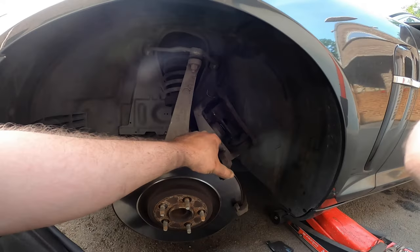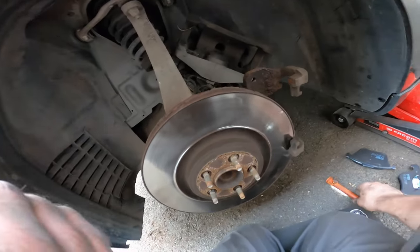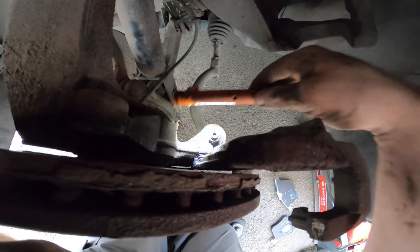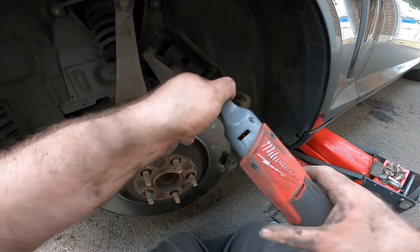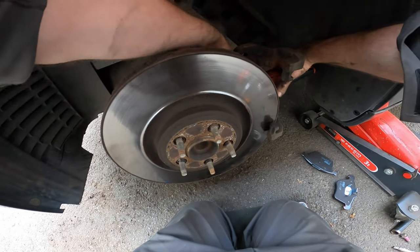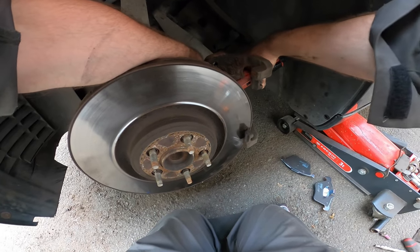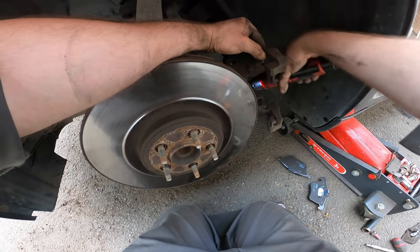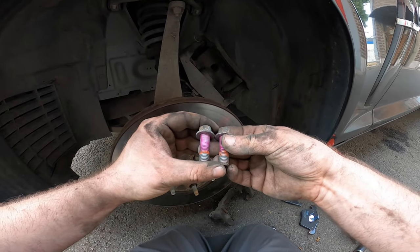Now you should be able to remove the clamp. So turns out I loosened the wrong bolt. Maybe I should give you a visual. So these two, this one and top one, I loosened the one in the center for the bearing, but that's not it. So mistakes, hey, it's life, man, it can happen. So lefty loosey, of course, and 15mm as well. And there we go. And this should have the same length, yeah. Yep, that's better.